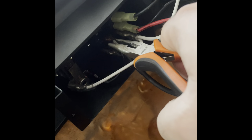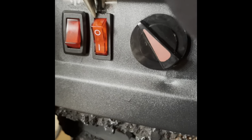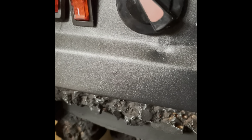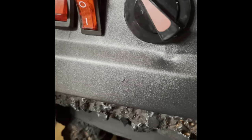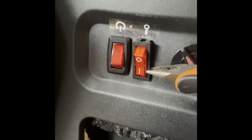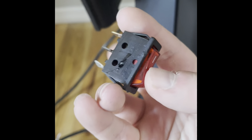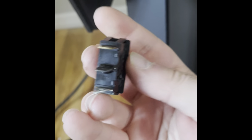It's a little tight, so I don't want to damage it by pulling too hard with my hand, so I'm gonna try pliers to get it dislodged. If you break it, you're gonna be splicing some wire together, so try to avoid that if possible. Now that I've gotten my spade connectors released, I don't really care about this switch — just trying not to damage the body of the unit. The switch I can pretty much wreck because it's no good. It looks like the rocker has died — it's not making connection. So I'm just gonna pry my switch out. You can see this is a three-pronged rocker switch and it doesn't connect anymore.